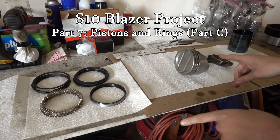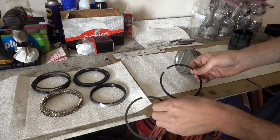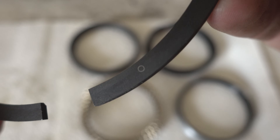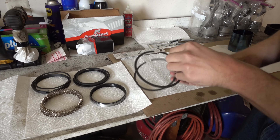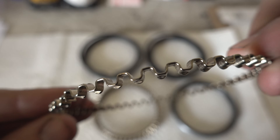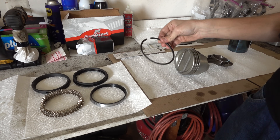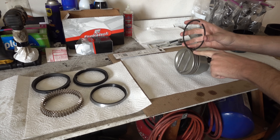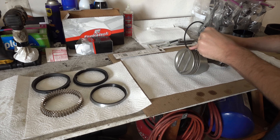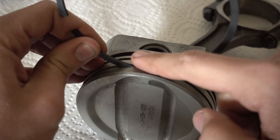Now we're getting ready to install the pistons, but first we need to check out the rings. This set comes with two different kinds: one has a bevel and one does not. The one with the bevel has a little dot to show which side goes up — that's the top ring, and the one without the bevel is the bottom ring. We also have the oil control rings and the grooved oil control rings. These rings should be pre-gapped, but that doesn't mean we can install them without checking the gaps. Another good thing to check is the depth of the ring groove — make sure there's no buildup so rings don't bottom out on the ring land. As long as the shallowest point of the ring is below the surface of the piston, you'll be fine.